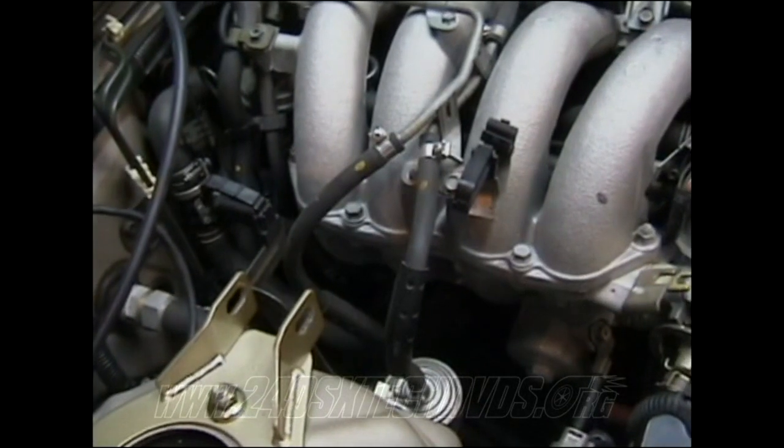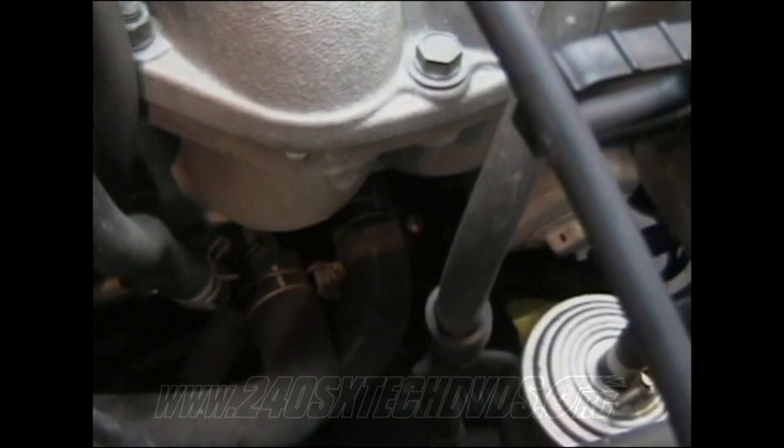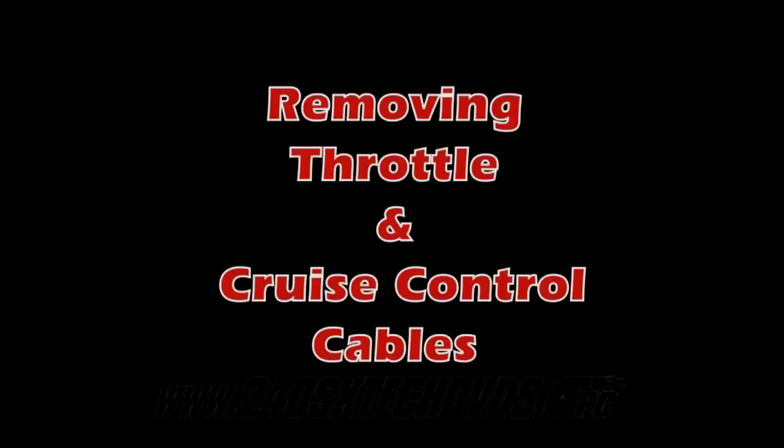You're going to want to remove your heater hoses from the car to the motor. They run down here. You have two of them, an inlet and an outlet. Right there is where they connect. They both have two 8 millimeter clamps on them that you need to remove. You can leave the other ends onto the car where they go into the firewall. It'll be okay. Have your pan ready for that, because that's going to leak fluid as well.